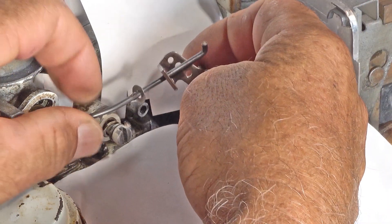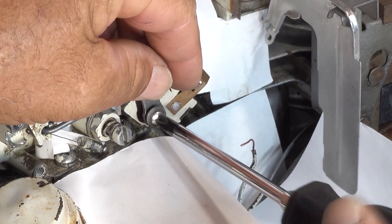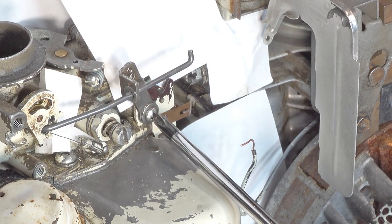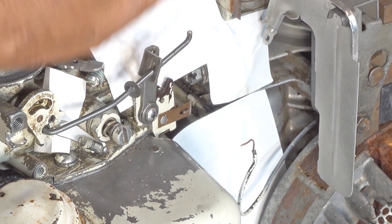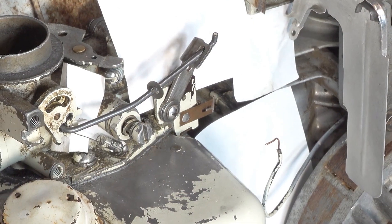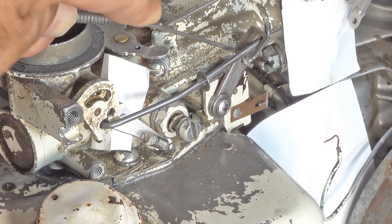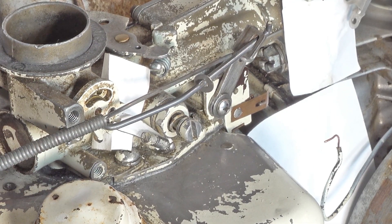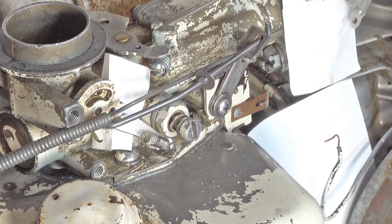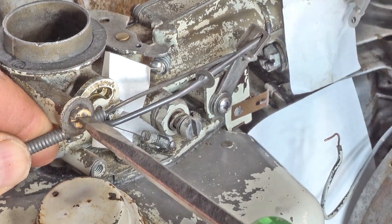You have to take that lever and put it through like this, then all this goes into that screw hole right there. It goes down like this. Even though I tighten this screw down tight, this lever still moves really easy. Once you've done that, you pull 100% back on this cable, move this out of the way. This cable on mine goes in the bottom hole, so it just goes in like that. Then to adjust — because we've already pulled back on that cable — we come right here pushing to the stop, then screw this in. That's how you put the throttle assembly together.